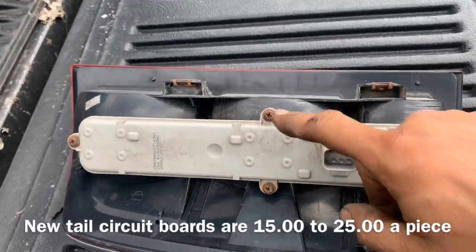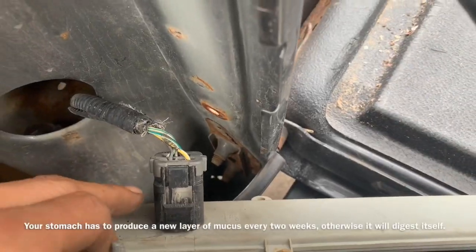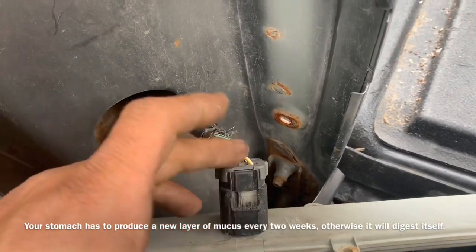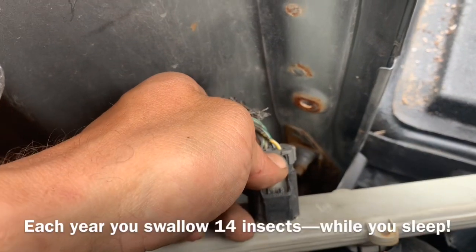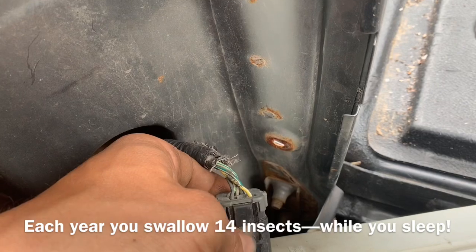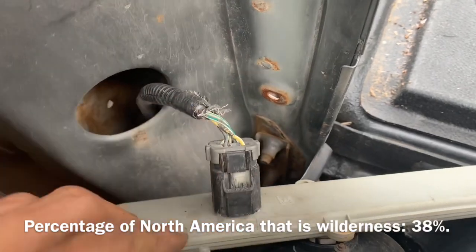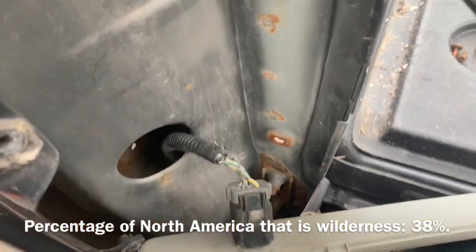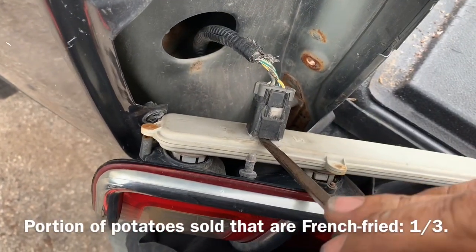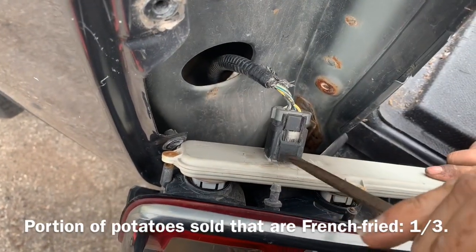If you're like me and you can't get it to unplug, you can remove the four Phillips screws that are holding it on. Now we're going to unplug the plugs on the back. If yours are like mine and they're super stuck - somebody had already kind of got in here and broke the clip - you're supposed to push down on this and push it forward to allow that clip to pop up underneath that ridge. I took a screwdriver, wobbled it underneath here, and while pushing on the clip I was able to raise it up off there.